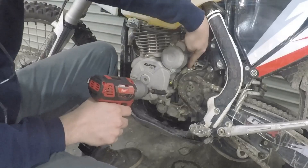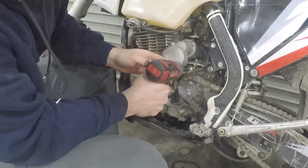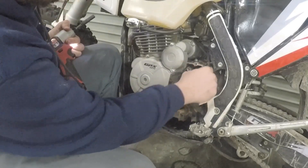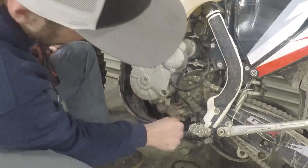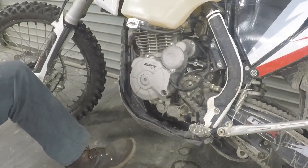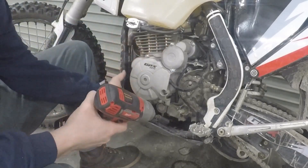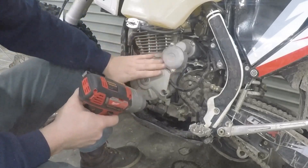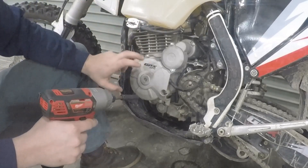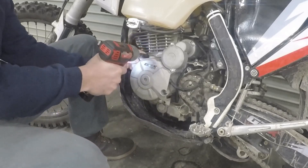Now there's a bolt in here which presses the wiring harness out of the way — I'm just going to remove that to get it out of the way. I found that when I took this apart the first time the wiring harness made it a little difficult. This is also a good time to make sure you don't have any dirt and debris that's going to fall down in your motor. I took the time before I turned the camera on to clean all around the mating surfaces before taking this part off, so no dirt falls in there — you are going to be exposing the inside of this motor, and that will shorten the life expectancy of your bike.